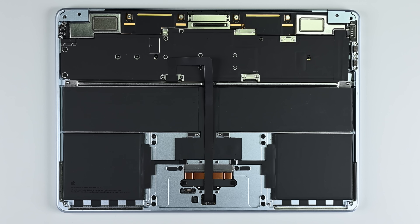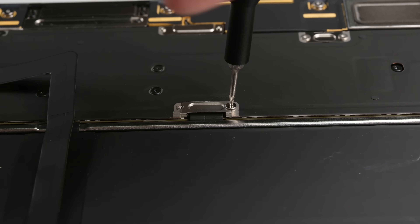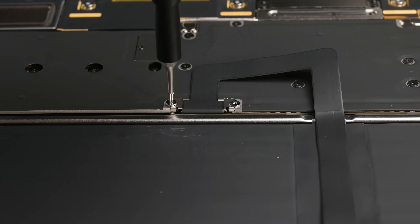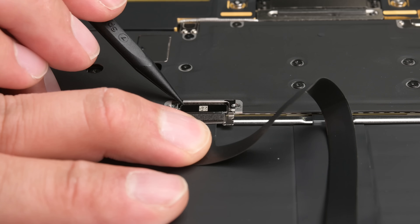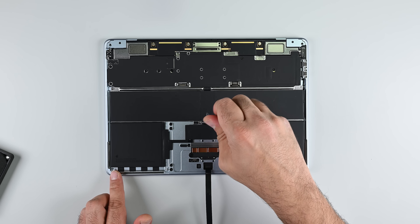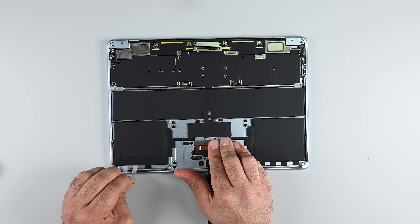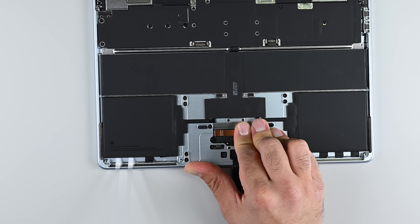The primary goal of performing a teardown is to see how repairable a device is, and at the top of the list of components to check for is the consumable lithium polymer battery. Disconnecting the battery is easy enough, and with the device made safe I can go ahead and disconnect the trackpad connector too. There are four screws to remove from the battery tray, and unfortunately this year's MacBook Air still doesn't include the amazing electrically releasing adhesive we found in the new iPhones, so I'll have to deal with these stretch release tabs.